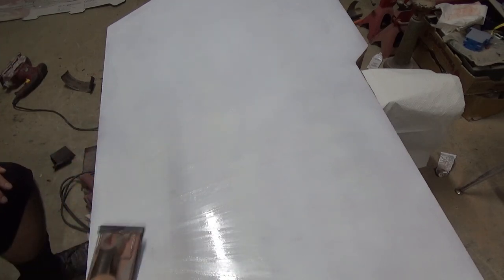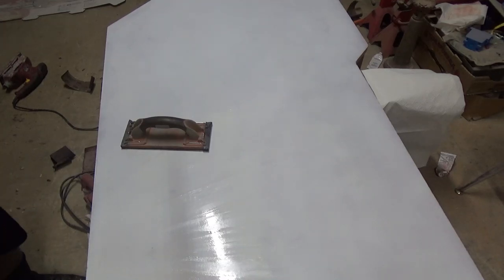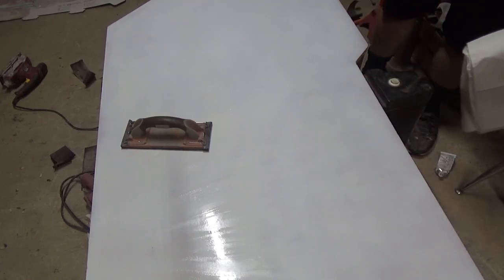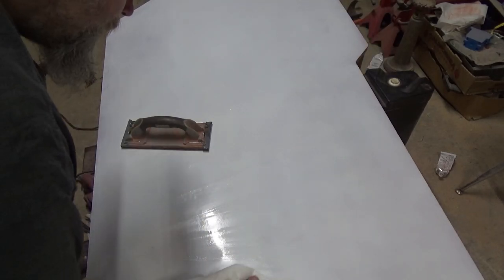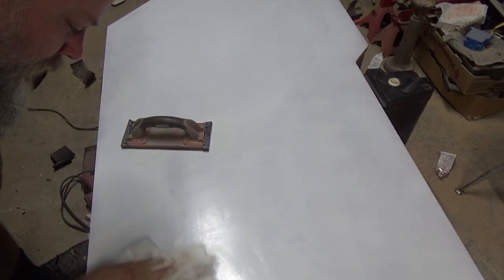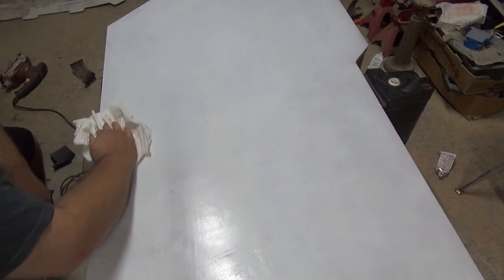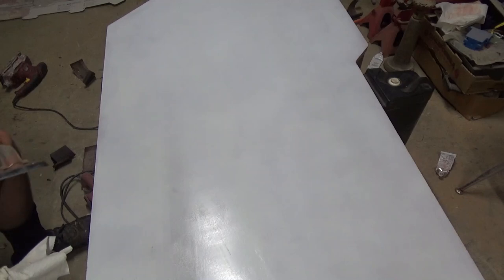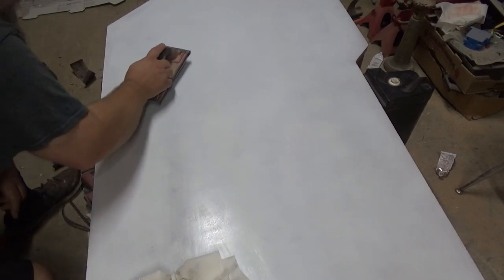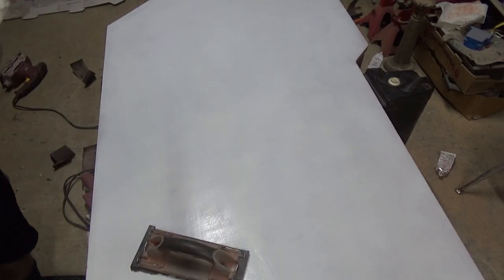Damn good woman. Anyways, what I'm doing is wet sanding. This is that same stuff that I applied the side art with on the other side. Just a drop of soap. I'm giving this a little light sand and wiping it off. The only reason I'm doing that is to get rid of any tiny imperfections, little high spots. Like over there, a bug landed right while I was painting. Bye-bye, bug. So I'm going to wet sand this whole cabinet.